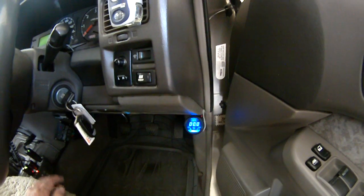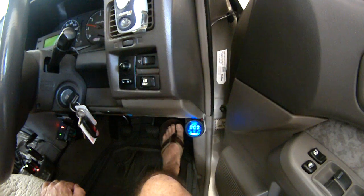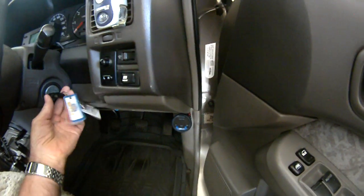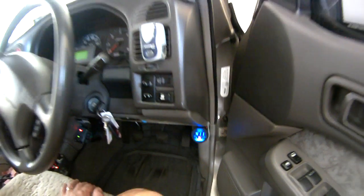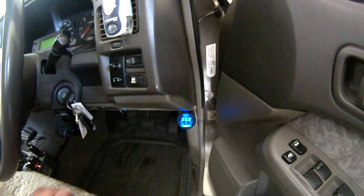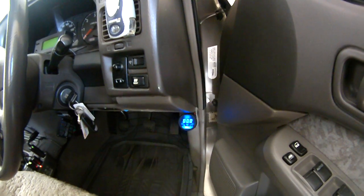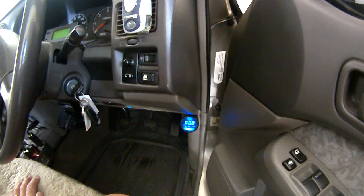I expected it to cut out and just wanted to make sure that it did. After it cut out I came back home and reset it, and now it's ready to start. Even though this is a controller it is also a gauge. I purposely didn't mount it up in direct vision, simply because the three numbers can blink very quickly and it would just drive you crazy. I fabricated a bracket myself and mounted it so it's hidden by my right wrist on the wheel — if the fault light glows I can see it, and if I want to check the reading I just move my wrist a few millimetres.